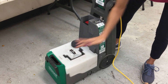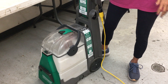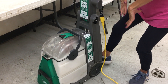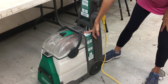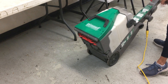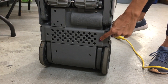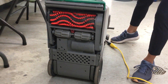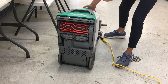Otherwise, if you experience leaking on this unit, we're going to ask you where it is leaking from on the unit. If it is your flow indicator, it may have water in that small solution hose port and it may very well be depositing water right underneath the left rear wheel, because that is directly underneath where that flow indicator is. Lean it back as I have done, and take your tanks off first since you're going to have liquid in them, to identify if that's where it is.